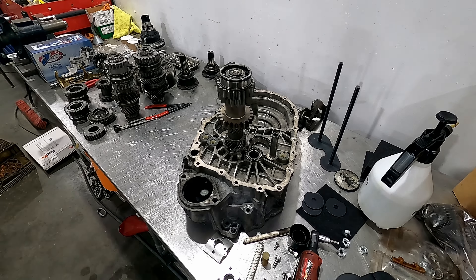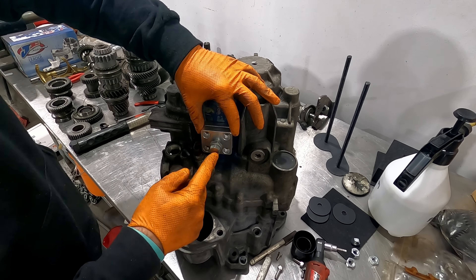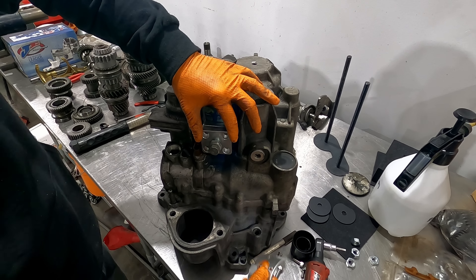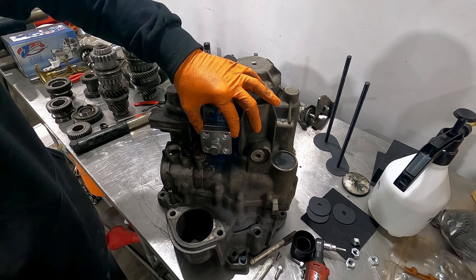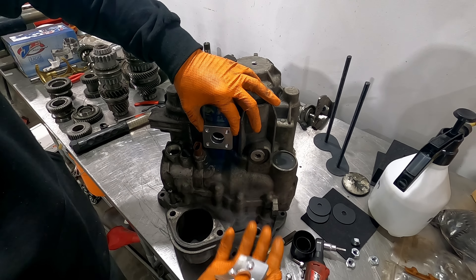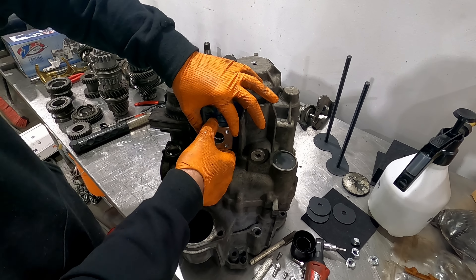We got this fitted. The only thing to watch out for is the sensor — it's close, but I literally just put the transmission on the ground and plugged the connector in, so it's going to be no problem. The whole point of this piece is that it pushes on the brass pin and pushes up against the shaft. The inner piece is going to go on the inside of the transmission and bolt into the outer piece, sandwiching them together. We just need to drill four holes to screw the inner piece in — the screws are countersunk — and then we can start final cleanup, final assembly, and check the backlash on the diff.